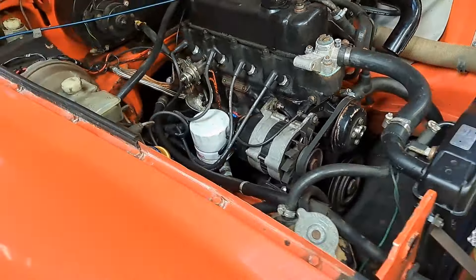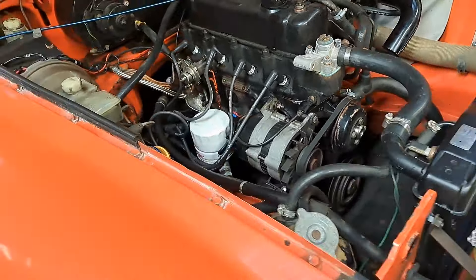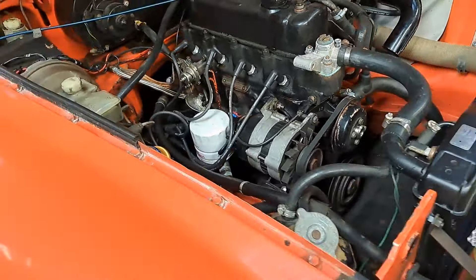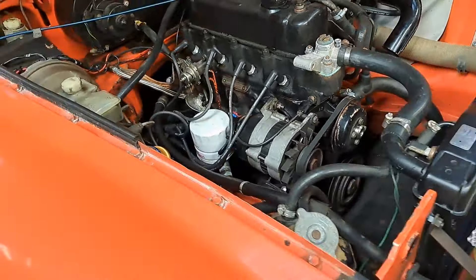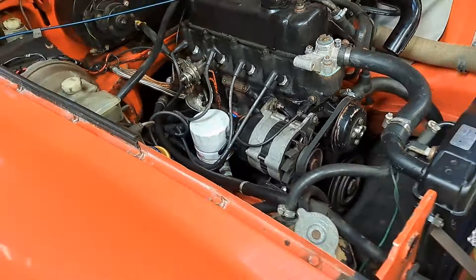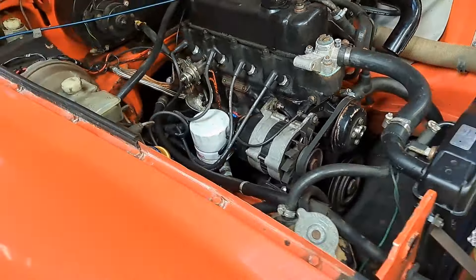Right then guys, we're back on this. I've took the valve housing off and look - block solid, that's supposed to be hollow. The outlet pipe - block solid. The core into the engine - block solid. That is all... there we go, it's just skinned over. Now we've got movement - there we go, that's why the heater wasn't working. We've got a bit of movement now, that one's cleaning out. And that my friends is why you should not dry store your car for a long period of time with antifreeze in it, because all it does is turn to jelly and block all the cores up. So we'll get that cleaned out now hopefully - just look at that, it's like cleaning your ears out. On that side - breakthrough! And all it is, is just congealed antifreeze over the years.